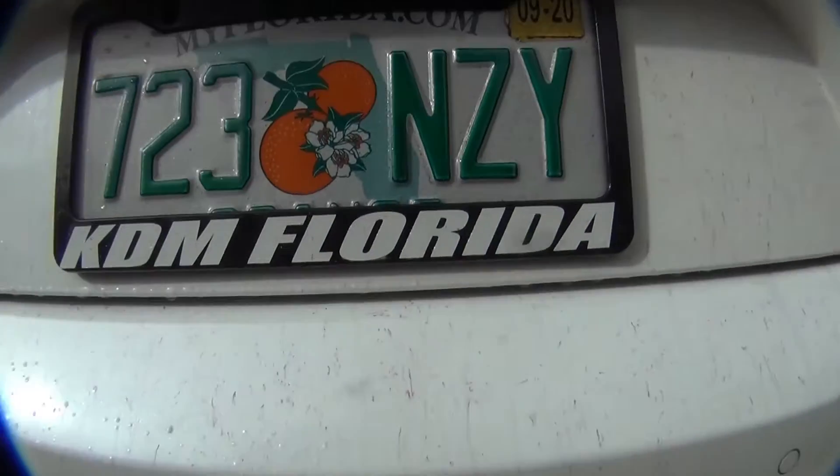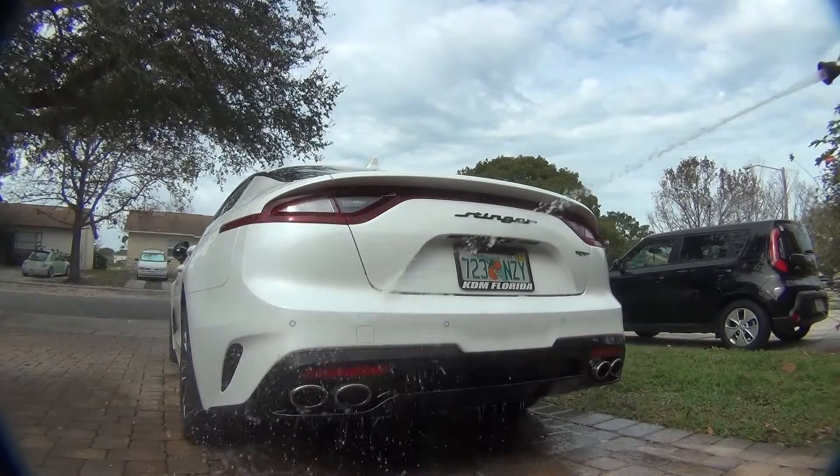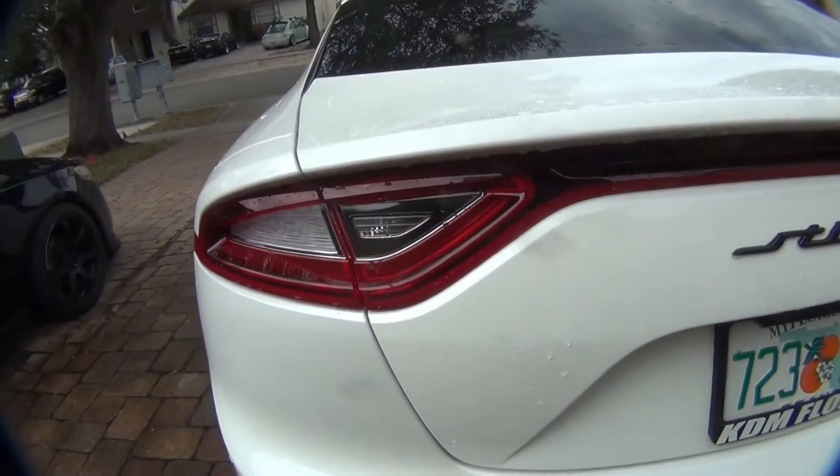As you can see, it's turning purple, and that means it's working. We're going to let it sit for another four minutes, then we're going to hose this off and maybe hit it another time. We're about to really help the paint with this stuff. It smells really good too. If this stuff doesn't work, you're going to want to use a clay bar.